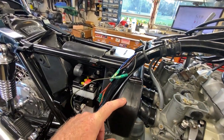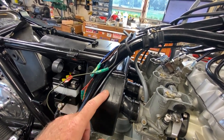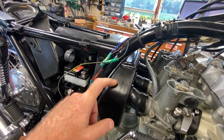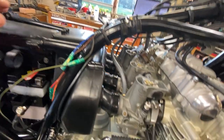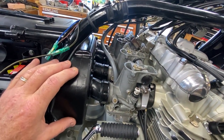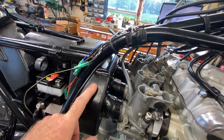This is a replacement airbox — the correct airbox. It was full of junk on the inside. I thoroughly scrubbed it, prepped it, and painted it with VHT very high temp plastic matte black paint. It came out real good. You can see that this lid is much higher, which allows the installation of the silencer. That all went in flawlessly. It's a lot easier to get the carbs out and back in now because this sits a little bit further back. So this issue is solved.